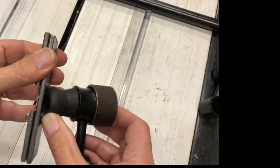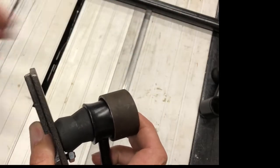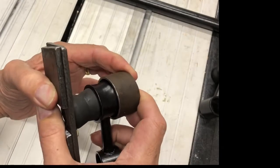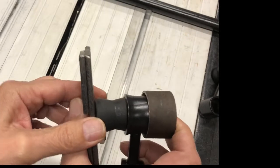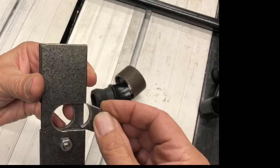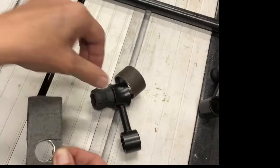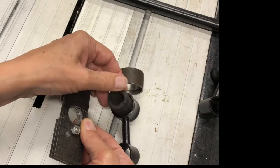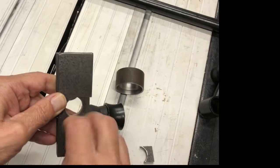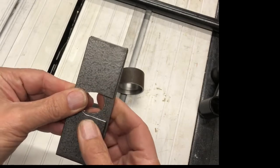And then hopefully I will be able to put a clamp around here, G clamp, or maybe one of these sash clamps, and force the whole thing in with a bit of lubrication. That's the plan anyway. I need to weld this into there so that there's an even support on the back end of the bush. And I've made it split, so let's take this apart so I can get it off over the bar, and then get it off after.